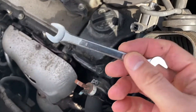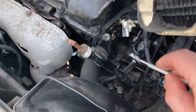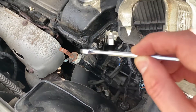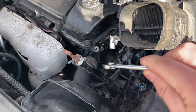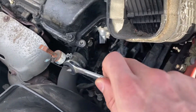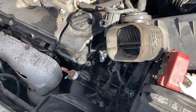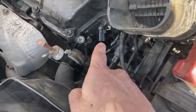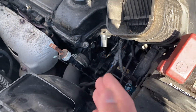I didn't have the actual socket — I dropped it — so I ended up using this 10 millimeter right here, slowly working my way with the bolt. Just to let you know, it is a 10 millimeter, so you could use that. Obviously if you have a socket and a tool it's going to be easier, but as you can see the bolt's right over there. It is plastic, so don't over-tighten it. When putting the sensor in it's going to be a little tight — give that O-ring a little lubrication and get it in there; it takes a little bit of a push.